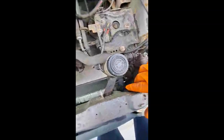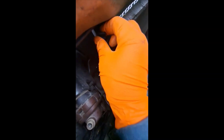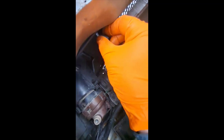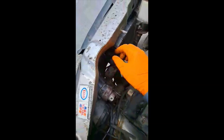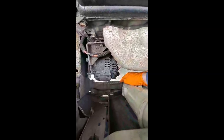The next thing I'm going to do is drain the coolant. There's a cap here — that's your power steering fluid, don't touch that. There's a cap here; if you unscrew it, you can take it out completely, but I'll leave it in a small bit. There's your coolant — you can see it, just press down that pipe, see the colour of it. That's why the radiator's being changed; it's probably never been changed in the car before — it's 25 years old. Unscrew that as much as you can and then drain it. This pipe over here should get rid of most of it.